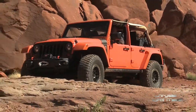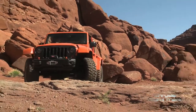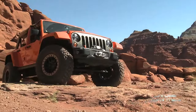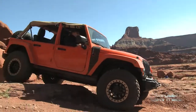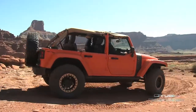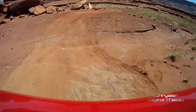On Mojo, the unique thing is we again use a 2-inch lift kit — the same kit as the first vehicle — but what's unique here is we have our high top fenders. The high top fenders give us an additional three inches of clearance, so instead of a 35-inch tire we can now go to a 37-inch tire, still with a 2-inch lift kit.